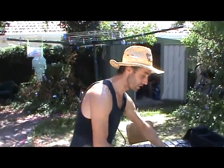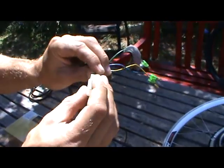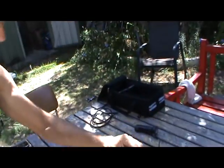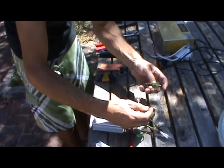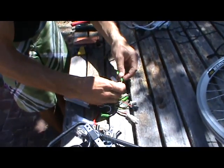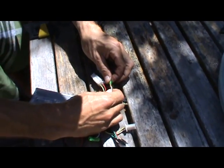So I'm going to show you how to put it together. The cable from the motor has three power wires — yellow, green, and blue generally — and these are your hall sensor wires. Make sure they're all tight and no pins are bent, then connect these to the controller. Everything can only connect one way, or else it's colour coded. You pull back the plastic, connect, push them together, and then put the plastic over the top — they come nice and tight. Blue to blue should work a bit better.